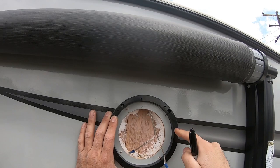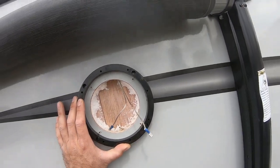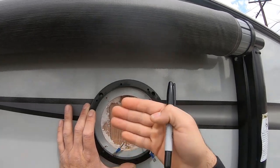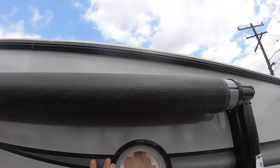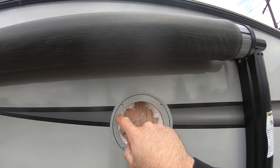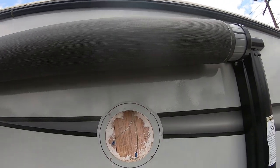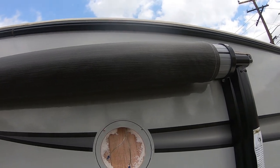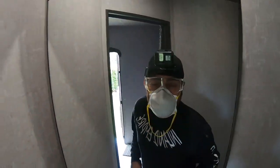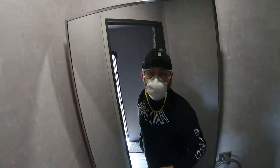These spacers are made for 6.5-inch speakers, which is what the Rockford 6.5 speakers are. The reason we're using spacers is because the depth of the speaker would hit the back of the wall — that's why an inch and a half is preferred, but we're going to use an inch. We're going to start by trimming the spacer. I recommend a Dremel; that's what I've got. Make sure to have a mask and glasses — you don't want to be breathing any of this stuff in, especially if it's fiberglass.